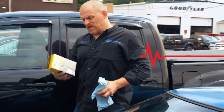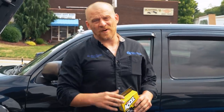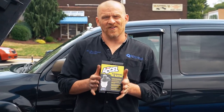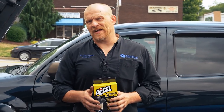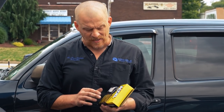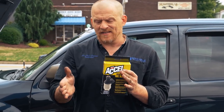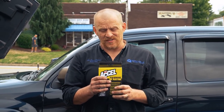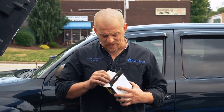My friend Rick, who owns this, Rick Schneider, he is a carpenter. He actually built my back porch. I prepped him for shorted injectors on this car. He went out and bought some new ones. You can't get these from the factory anymore, I believe. Way too old. What I asked him in particular was, did you make sure that these injectors were the exact replacements for this? They're not bigger, higher flow injectors. He said, no, these are the factory injectors. And I said, good. So he's got a set of 8 fuel injectors for this.